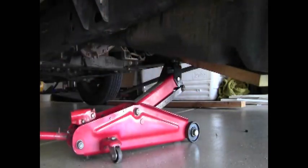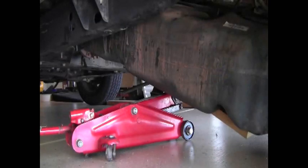Lower it with the jack just a tiny bit and try to get underneath it to reach the connectors. I pulled the filler hose off — on top of the tank there's enough slack to let it down. There are connections in there that need to be taken off. Go ahead and lower the tank gently, making sure there's no tension on any wires and there's enough slack. The first connector: pull that little tab up and it pops right out. The next connector has a tab — lift up on the front and push it back. Take a screwdriver and pop that little tab out to release it.